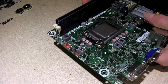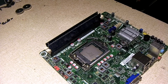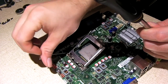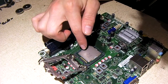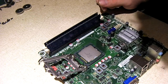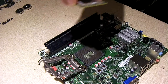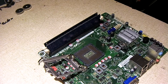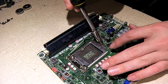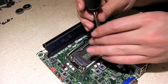This is the backplate we're needing here, so we'll pull that out. We've got to take the CPU out first — I forgot to mention earlier, this is a Celeron G460, SR0GR, 1.8 GHz. Yeah, it's a pretty low frequency chip. Obviously it'd have to be, to be a 35-watt part. I don't want to wreck those little bitty pins or pads on this socket.